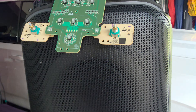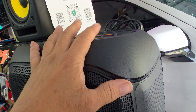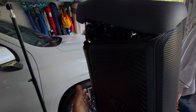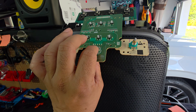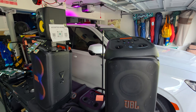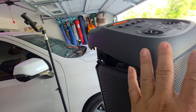Since we're unable to figure out what's wrong - it keeps rebooting and restarting - we are going to open my other 320 and test just the top controls, because I believe it's this board. To narrow it down, we're going to take it out and test it on the other speaker. I've swapped the top board from one to the other, vice versa. Both speakers are going on right now - we're going to see which one does the restart. So far they're both good. This one just restarted - so this proves the point. This is still good. No issues with the top control module, meaning the top piece on both speakers is good.